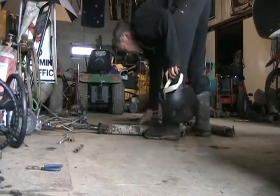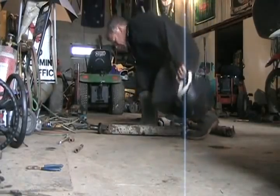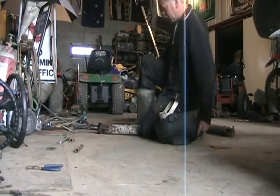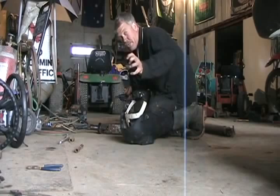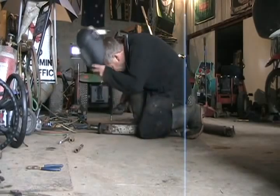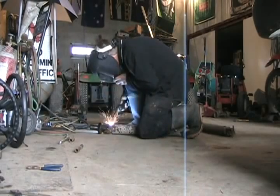And whenever you're welding something like this, you want to be nice and concentric for balance. Always make sure you do 3 or 4 little tack welds first because welding causes contraction when it cools and things will move more than you expect.